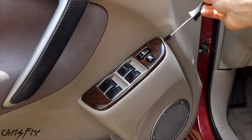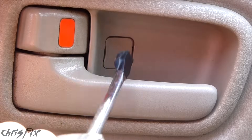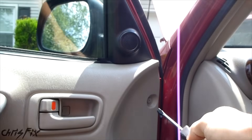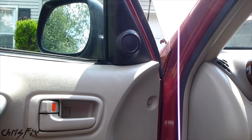You're going to pry from up here. In the door handle area you can see there's a little panel clip right there that you're just going to pop off, and then you're going to get to a screw in there. You're going to use your flathead screwdriver up here, pop that off, and then you have a bolt right there and you'll get the whole door panel off.